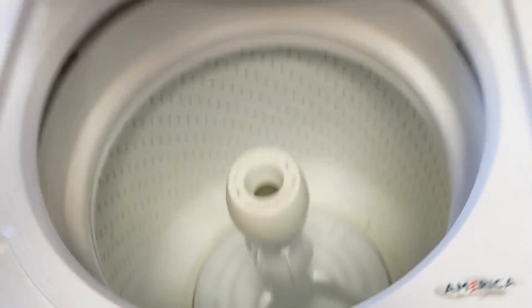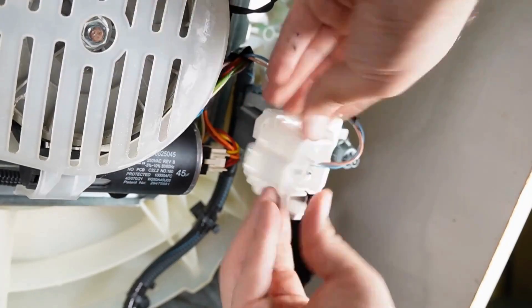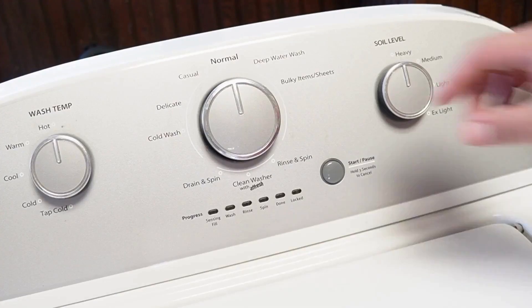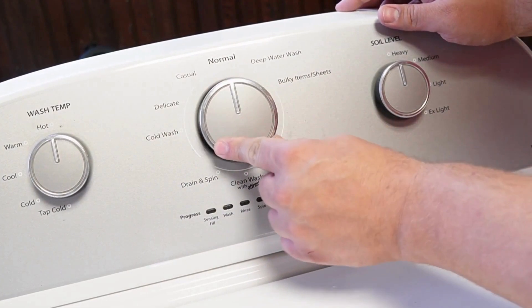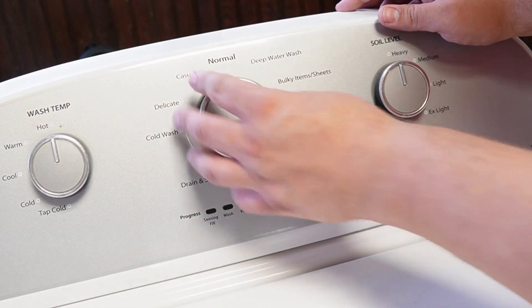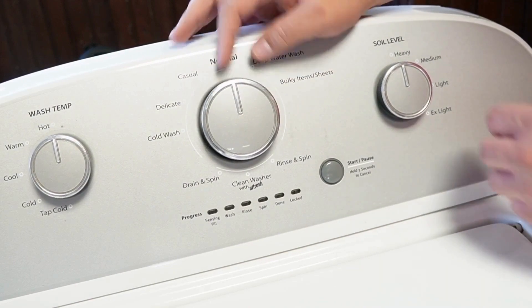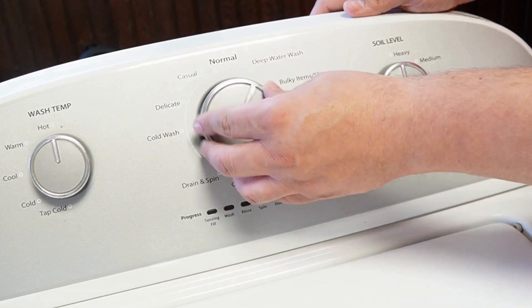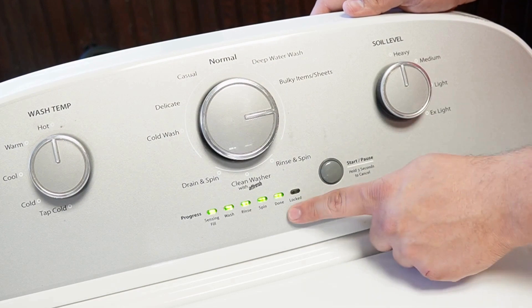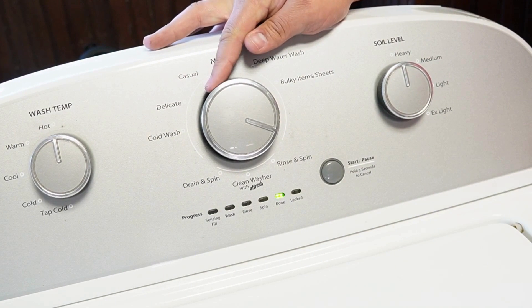Now let's attempt to recalibrate this washing machine through the calibration mode. This is a must-do if you've installed any new parts — from a board to a balancing rod. With the washing machine freshly rebooted, rotate the dial again counterclockwise 360 degrees. Then turn the knob right three clicks, left once, then right once again. You need to do all these things within three seconds, and it may take a few attempts. If done right, all the lights at the bottom of the washing machine control should flash on and off, showing that you've entered into diagnostic mode.